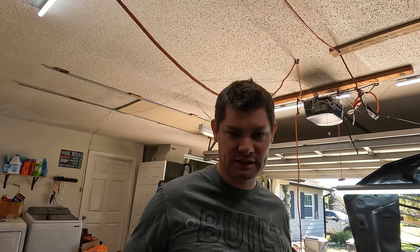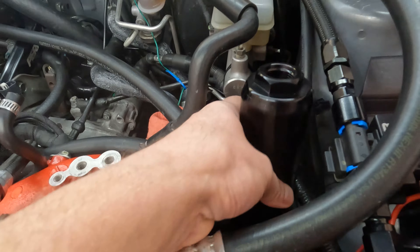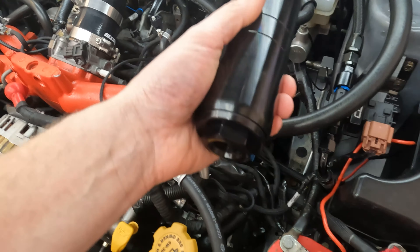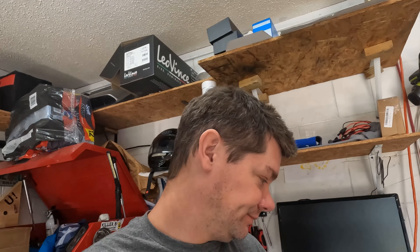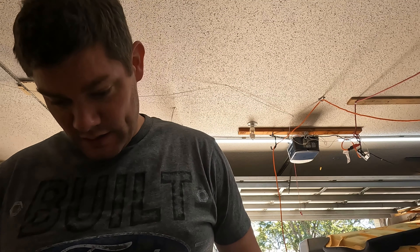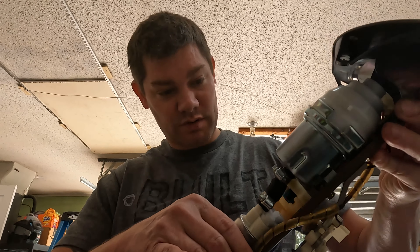Those are the two things I decided to pick up. As far as placing everything — these are dash-10, so they're big. The giant filter pill has to go somewhere; we'll figure that out. Right now I'm going to switch out the fuel filter — go into the OEM fuel hanger, remove the OEM fuel filter, and put in a hose instead. Come along.